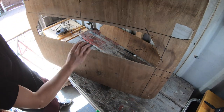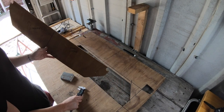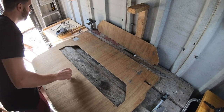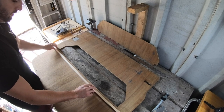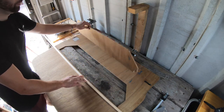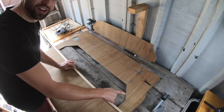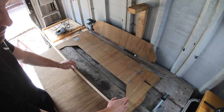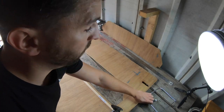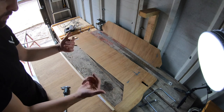Spend the time cleaning it all up like this. Six mil ply. So what I'm thinking is screwing it to the bottom along here like that, allowing for the six mil so that I can screw that like that, and then we can build around. This cut here is going to make my life hell as a non-woodworking guy. This is going to cause me some dramas — I'd imagine that's like a 45 degree angle. If you remember we've got six mil ply. We're going to drop this down six mil to give us a ledge, and we're going to screw it in from the front face and countersink.